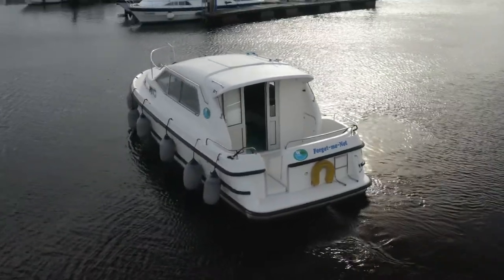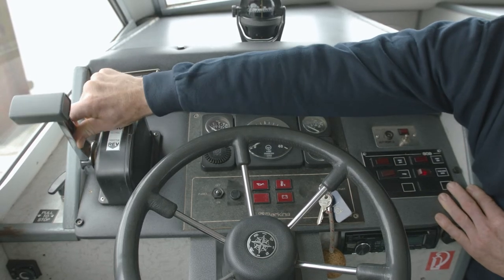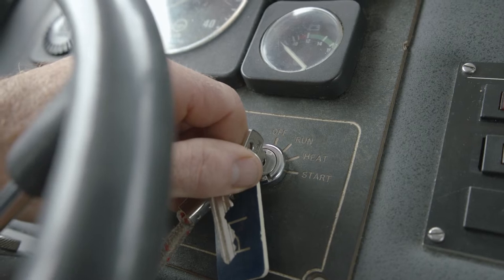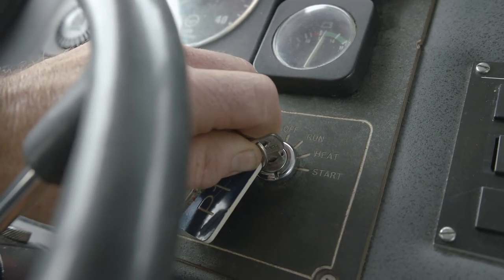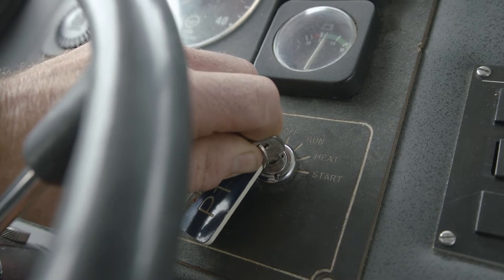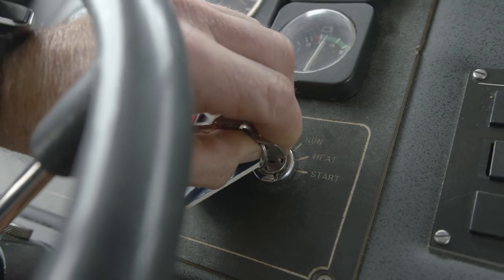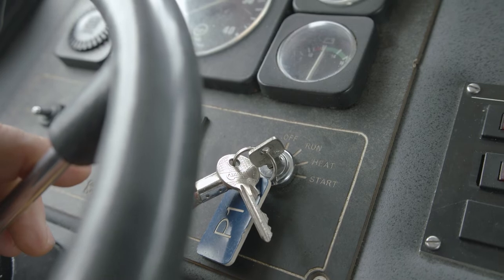To start your Wave Princess, you have the boat in neutral. You push out and just drop the throttle back. This will stop the propeller from spinning — it just gives you throttle only. Turn your key to heat and hold for a max of 10 seconds. After 10 seconds, continue to turn the key around to your right. Once the boat starts, let go of the key. It goes back into run automatically.